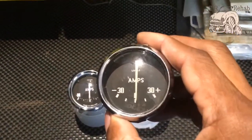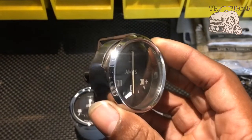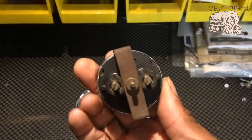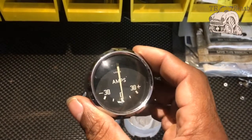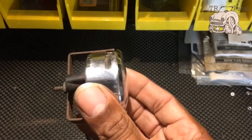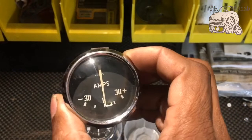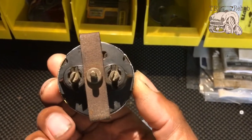Now here's something I probably don't have to tell you if you own one of these vehicles — the bezel on the amps gauge is slightly smaller than the other three: the fuel, oil, and temperature gauge. Not only is it slightly smaller, but it's attached to the actual gauge. The way you access it is through the back — you've got these little tabs right here and you slide that out to get inside it. The lens on the front is not as curved as the other three. It also has a light port which illuminates from the dash fascia and gives you the impression that there is a light there, but there's actually no light on the gauge itself.